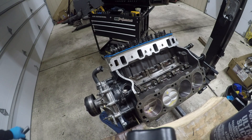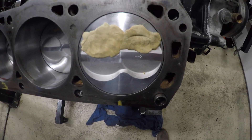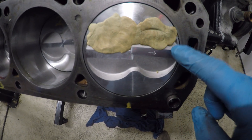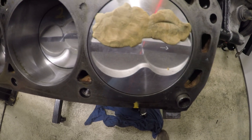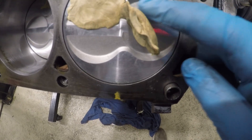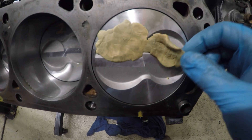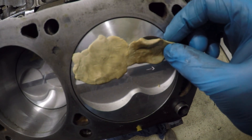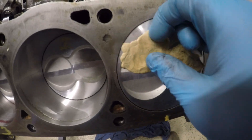We'll see how much clearance we have. I took off the head and I did notice a little indentation on this side of the piston. Although this is recessed inside, I think I am good enough. I have a much deeper clearance in there, so I'm perfect. I have enough clearance for that because this is pretty thick - it's at least a quarter inch thick. I'm pretty far away from that relief. And on this side, I never touch, so I'm good.